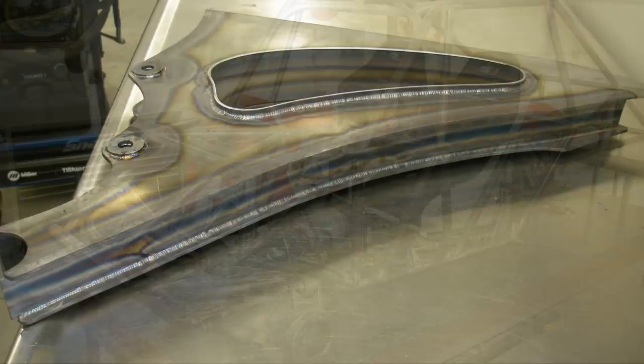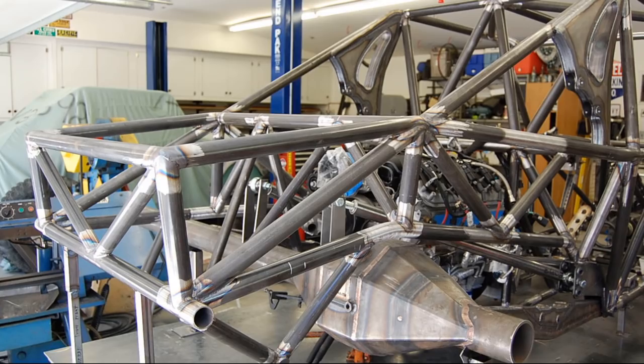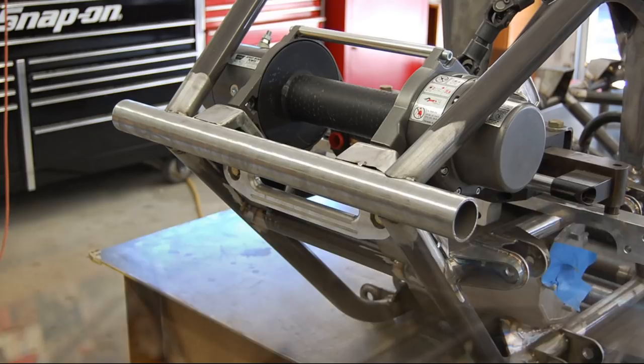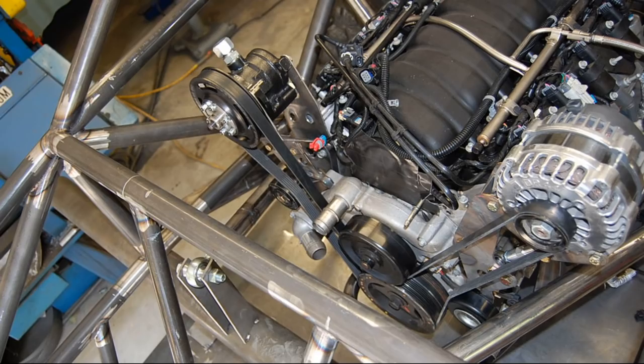The car was designed to place the occupants as far forward as possible with as little forward visual obstruction as possible. Making temporary upper control arm mounts on the axle — and it's going to need a winch. Since the accessories need to be mounted way up high to clear the suspension links, I had to make custom brackets.